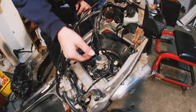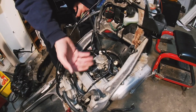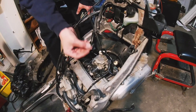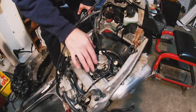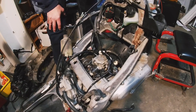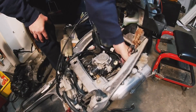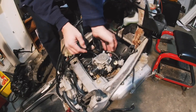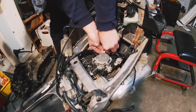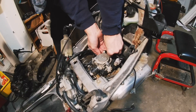Let me remind you — if you do not have the right tool, at least use a number two Phillips. Although the right tool is actually a JIS — a Japanese Industry Standard screwdriver. You still have to be really careful with it. If you use anything else you're just gonna strip pretty much every screw you try to touch, especially when the bike is older like this and has been in the weather a little.